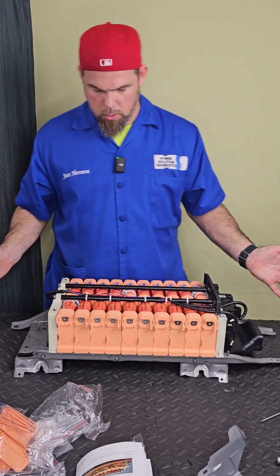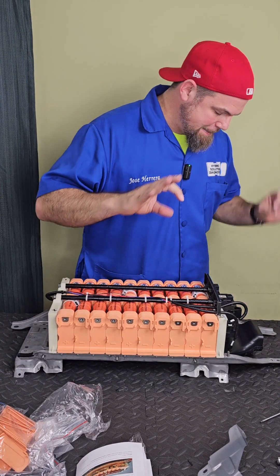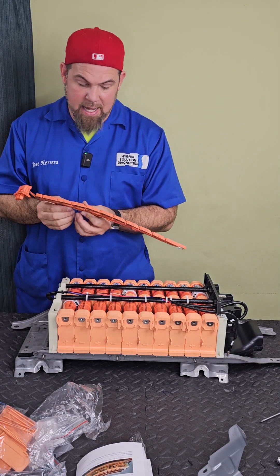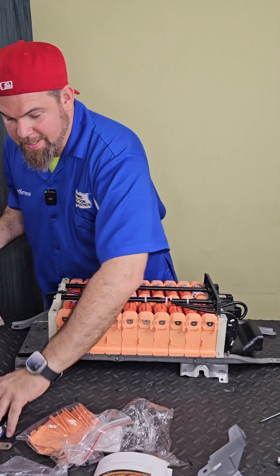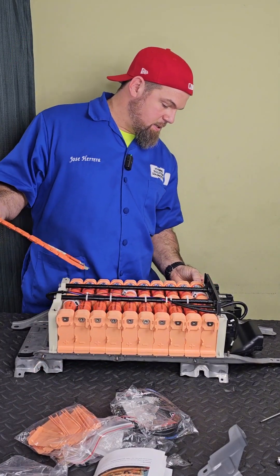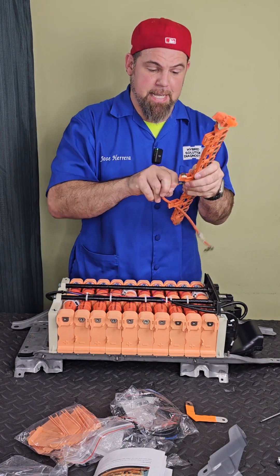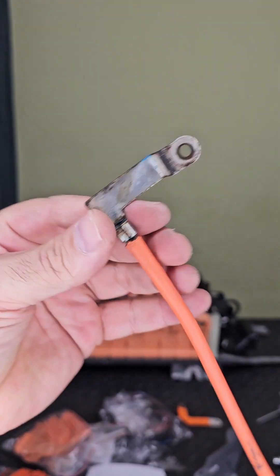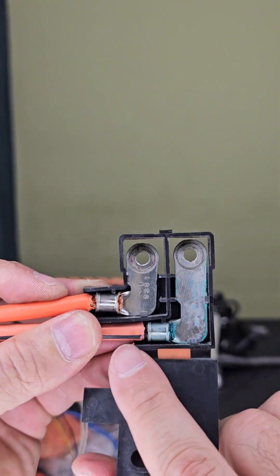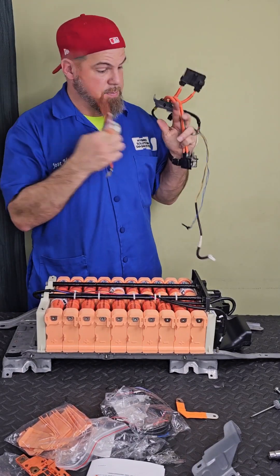How about that — it's actually looking beautiful! Okay, the other thing is very, very bad: I'm going to have to use the main negative cable. This kit brings the bus bar for the positive, which is okay, pretty good — but the negative is this cable. Let me show you the condition of it. This is the main negative cable — totally corroded, and look at the connection of the service plug: this is garbage. Unfortunately we're not going to finish this battery today because we need all these parts.